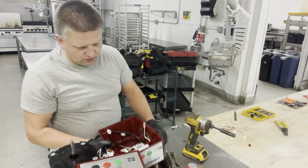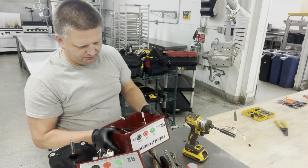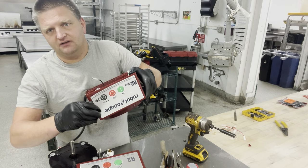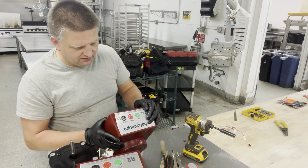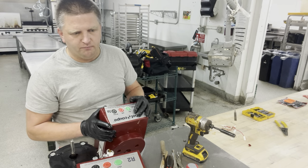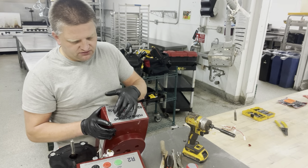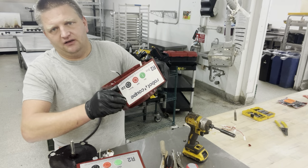And then in order to remove the switch assembly, which I am not going to do because I already have mine in place, you will have to remove the front plate right here. Slowly. Best way to do it probably will be to use a hair dryer or a heat gun, heat this plate up really well, slowly, so as to loosen up the glue. Once you have the glue loosened up, this one's already peeling off.